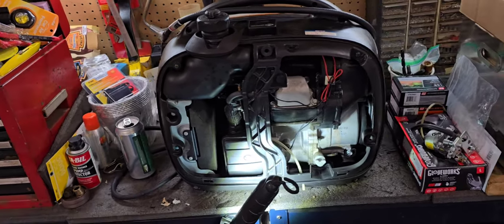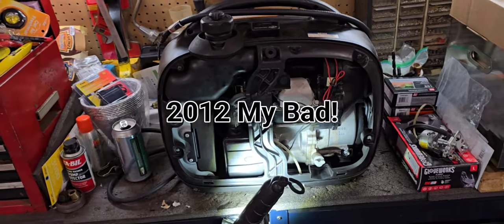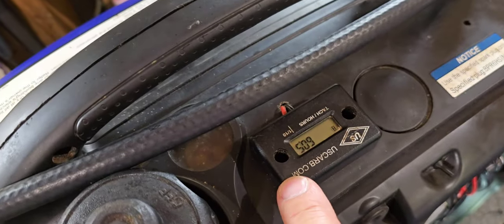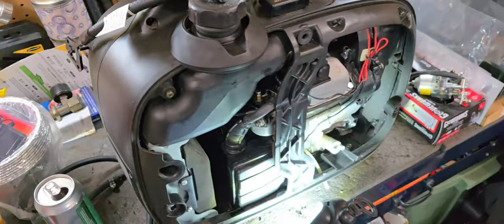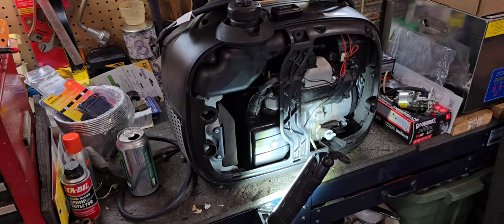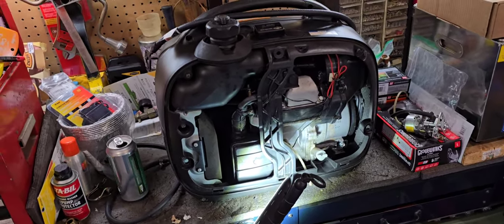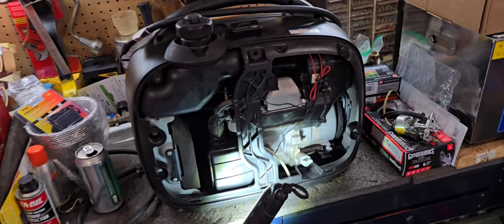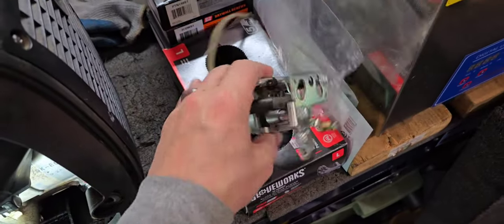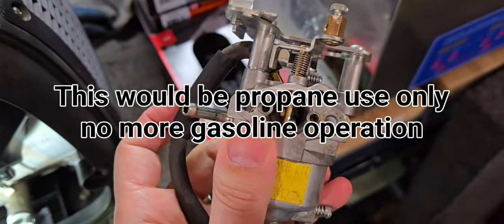He picked it up shortly before that, and I believe Hurricane Sandy was 2013, and he ran this thing for 7 days straight, and he put the hour meter on here from US Carb. It had 60.1 hours when I first got it, and it did not look as nice as it does. I've done an extensive cleanup off camera, and he did have this converted to propane using the US Carburation kit. But what they did not have back then was they would actually take the carburetors out and drill out the carburetor and it would go into the airstream that way.